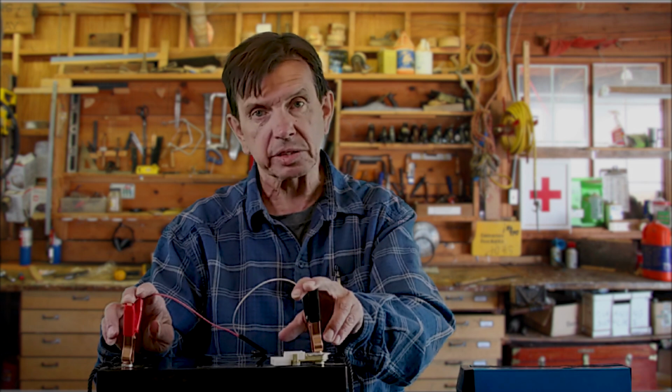Now, one thing about a float charger, trickle charger, or a battery minder is they are wired for different chemistries. This is an AGM battery here, but there's also flooded batteries, there's sealed lead acid batteries, and it's a whole different video for lithium batteries. For this, I've selected one that works for an AGM battery. It's recommended for my type of battery. This way, I feel confident that it can safely sit on here all winter long, maintaining this. So my battery is going to be toasty warm, completely full, and it'll be a happy battery, and I'll be a happy camper when spring rolls around.